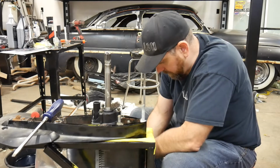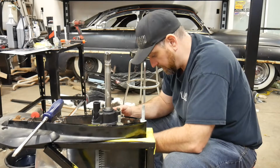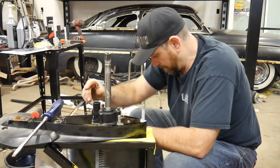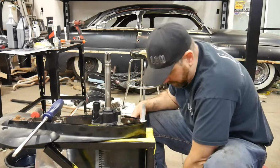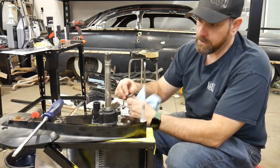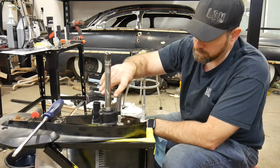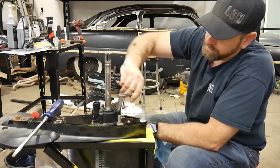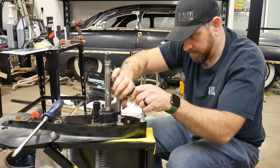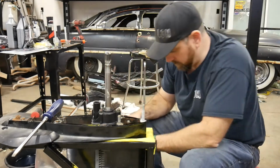Now, out of my kit here, I'm going to pull that new bolt out, because oftentimes people over tighten this coarse bolt, and that's why they get bent. I don't know if you noticed, I'm using just my quarter drive ratchet on this. None of this stuff needs to be extremely tight. These nuts have lock washers on, or they're lock nuts, so they don't have to be ridiculously tight. Just tighten it down a bit like that at first. Oh, need my other one.